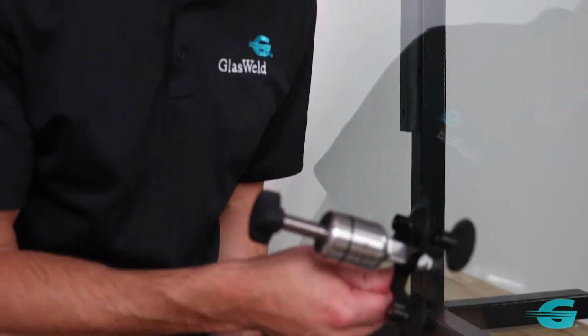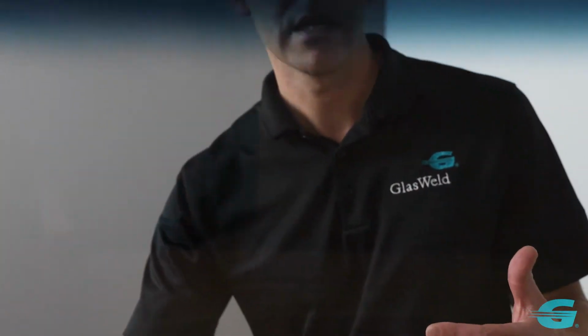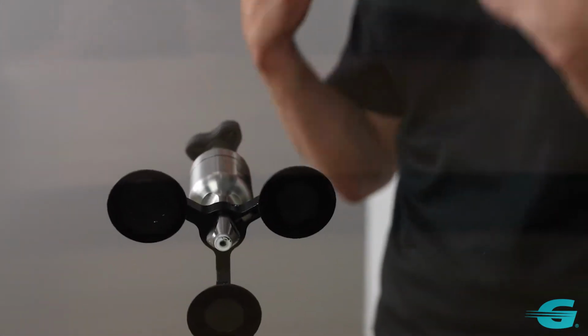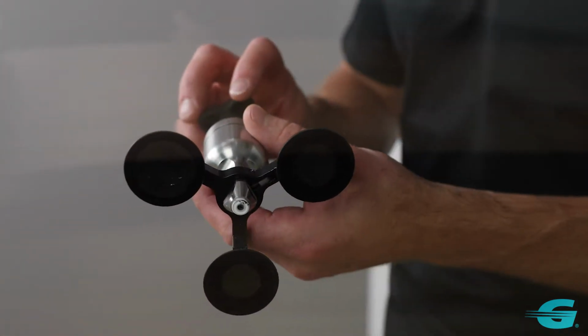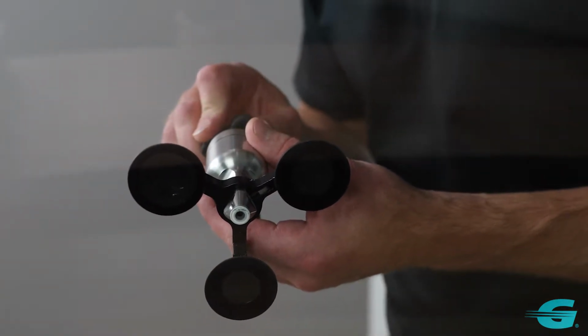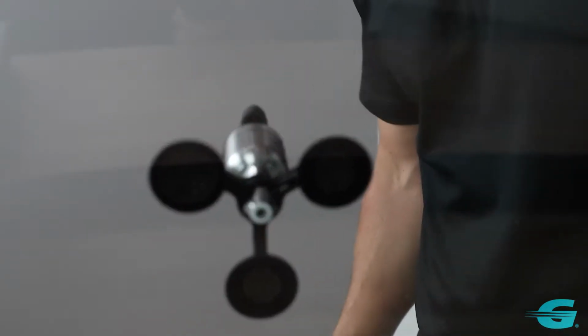Again, we've got the industry's strongest vacuum here, and the ProVac Zoom, one of the really great things about it that makes it really unique in the industry is ProVac technology, which allows you to sustain the vacuum while you inject the resin. So you're always in a vacuum state with the ProVac Zoom. And again, all we're going to do is just reverse it all the way back down, inject resin, see that seal swell, let it sit for a minute as the resin fills up there.